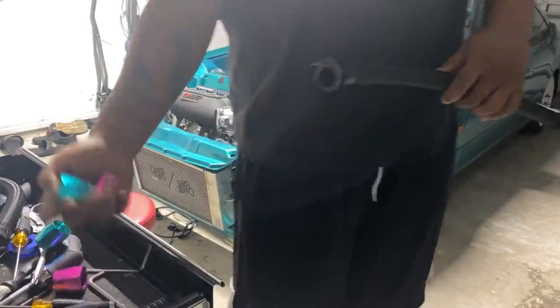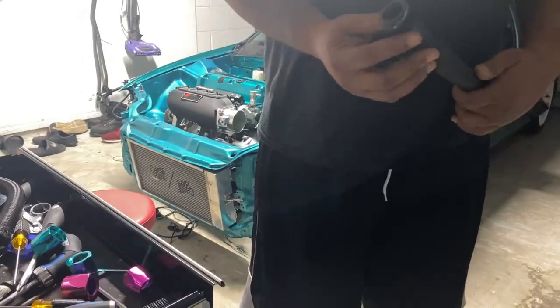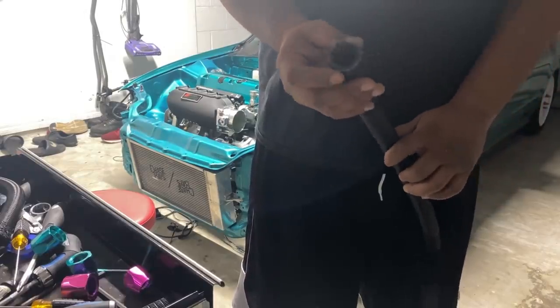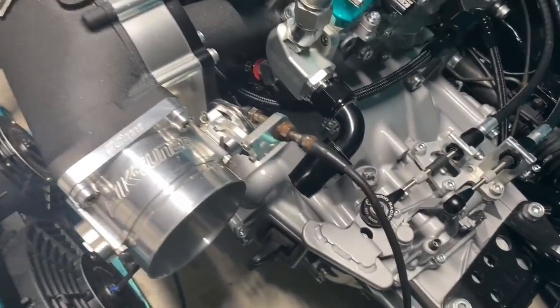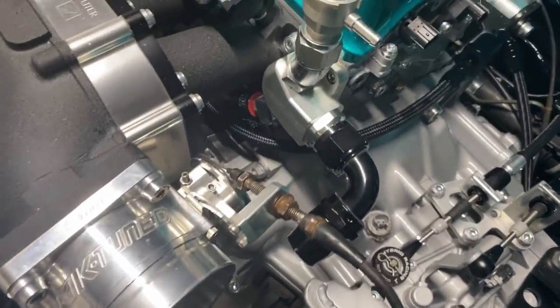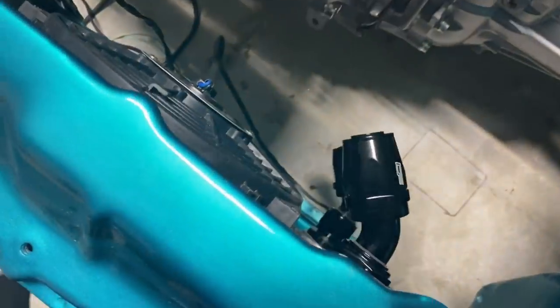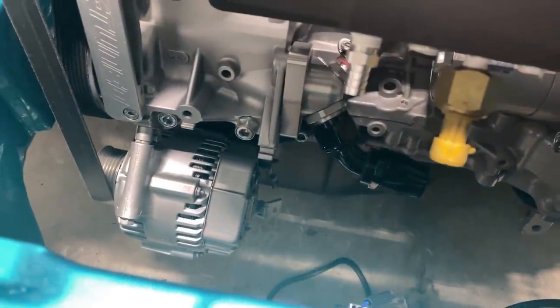This is how I do mine. I took off the old fittings. I get a piece of black electrical tape and give it like two good wraps real tight, because you want to keep the braiding down. See how it looks when it's all flared up — and I basically cut it. I have it marked up: I have a 90 coming off the upper cooling neck, and I got two 45s on the radiator and a 45 on the thermostat.